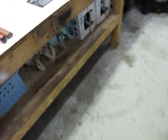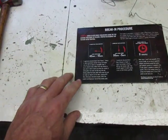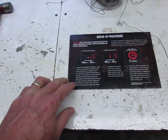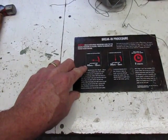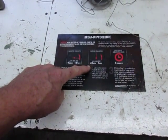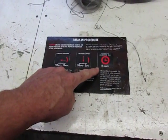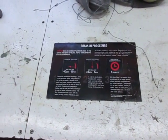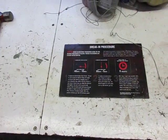So I'm going to try these Power Stop rotors — they look really nice. They also come with a break-in procedure that's a little different than I've ever used before. It says five aggressive decelerations from 40 to 10 mph, then five moderate decelerations from 35 to 5 mph, and then drive around to allow them to cool. I've never broken in rotors like that before — maybe that's my problem — but I'm going to follow this procedure and see what happens.